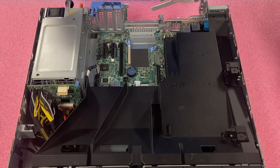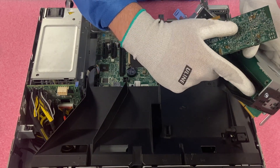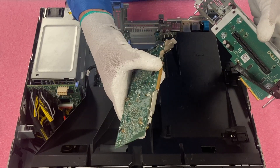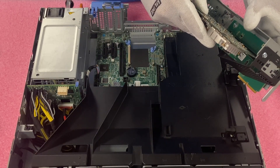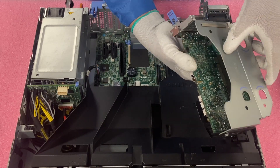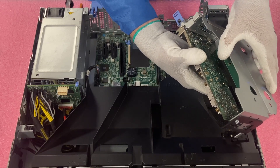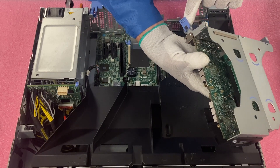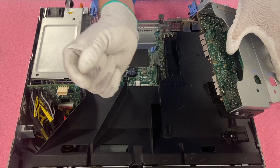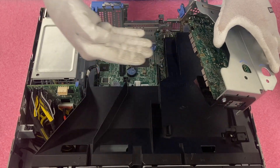I'm going to put in the RJ45 today. We're going to spin this around and make sure the tip right here is perfectly lined. There is a black piece that the card's PCB board will slide into, and then you have the two connectors — so technically there are four different points you need to line up. Start with the top with the PCB, slide it down, and you'll see the two connectors go in, the black pieces in, and the tip of the bracket in the back. Then physically push it in — you'll hear it click into place. Lock it in by putting the blue back down and the riser is firmly secured.